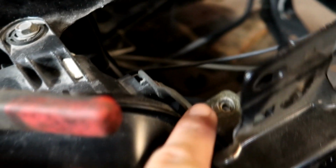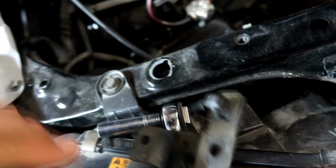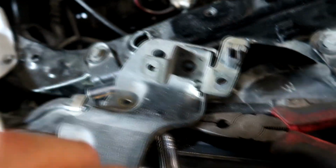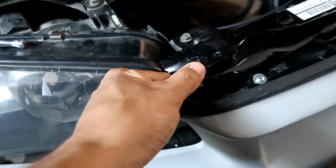All right, I'm just getting a bolt for here just so I could go ahead and attach this section here. This uses the OEM clips and that clip is right here. Just gonna need some needle nose just to take this out. All right, this is all bolted down nice and sturdy. Well, sturdy somewhat. Not gonna tighten anything down just because I'm gonna need to finesse this front lip here. I might have to take off the bumper on the sides just to fit this lip right over.